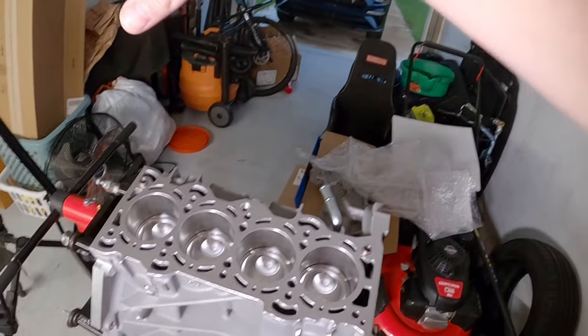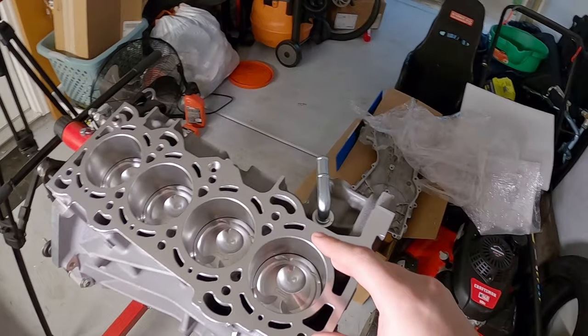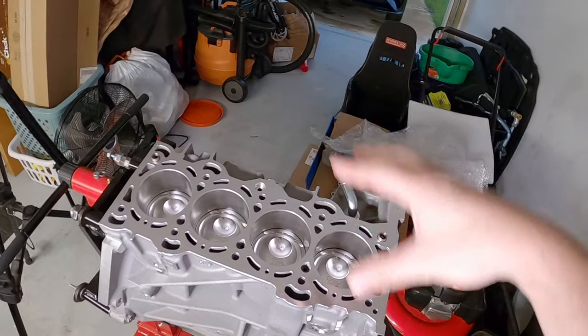The one thing I want to get done tonight is get at least the cylinder head mounted on the engine - the installation of the ARP studs, gasket, head, tighten it down, torque it, ready to rock. Timing is the only other thing that's got me a little worried, but once I get the cams installed and timed the rest is cake.